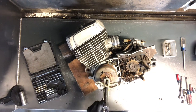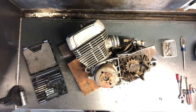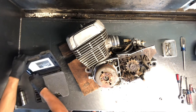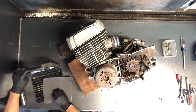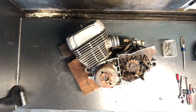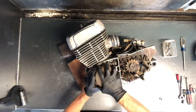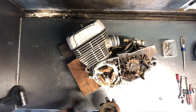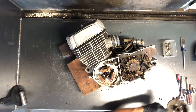We can just run these bolts out. Let me know if you need this puller — comment underneath this video and I can order it and send it to you. That's the only thing you need it for, but it is essential to have that puller to pull this flywheel off. I have never seen you be able to remove this flywheel without a puller like that.